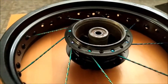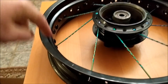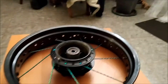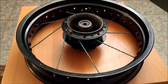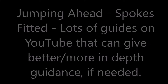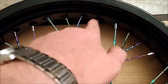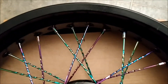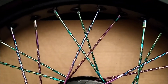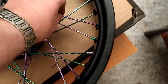I'm now at the point where I've done one half, and now I need to flip it over and do the spokes in the opposite direction. That's what I've got — this literally took me a couple of minutes to do. So it's laced up now. There's the individual pattern — two that way and two that way, crossing each other. They haven't been tightened up yet, I've just put them in, some of them are still loose.